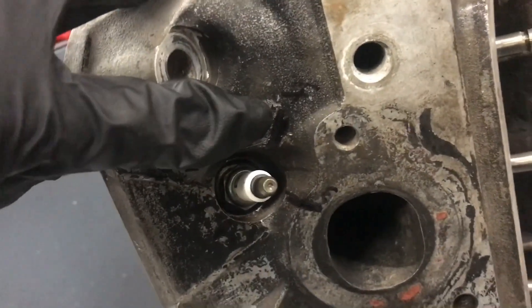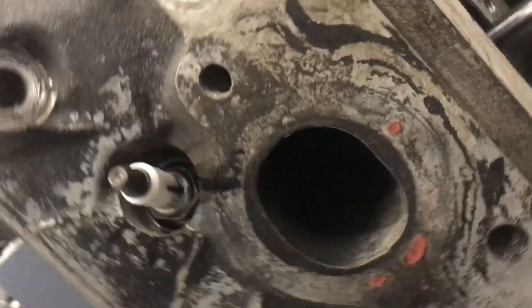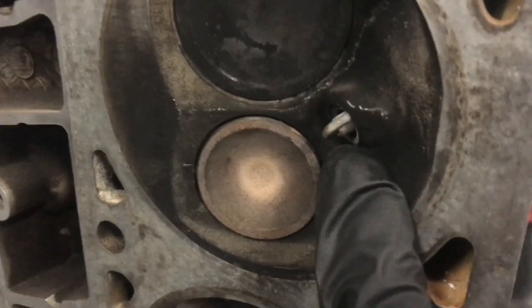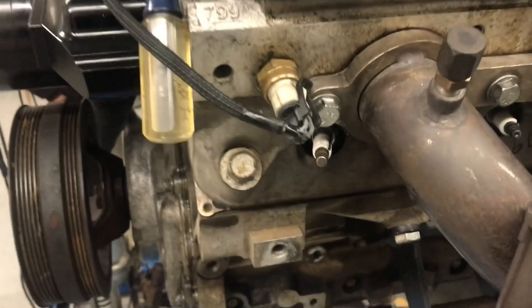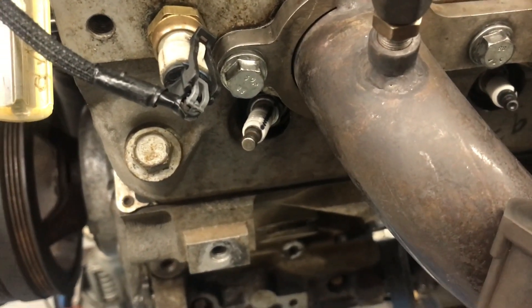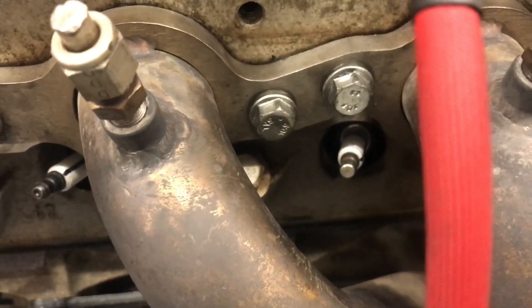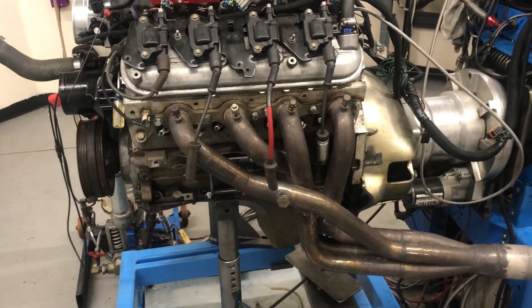We're going to take a look at our cylinder head once again. You can see I have it labeled here — this is where we want to aim toward the intake, and this is where we want to aim toward the exhaust. Now you can see we've got this one aimed toward the exhaust. Looking at the combustion chamber side, the opening is oriented toward the exhaust valve. Using our special washer stack, we've moved these and got them as close as we can. You can see that one's oriented toward the exhaust, this one too — those two are pretty close. We've got the other four on the other side. Now let's start it up and see if it changes.